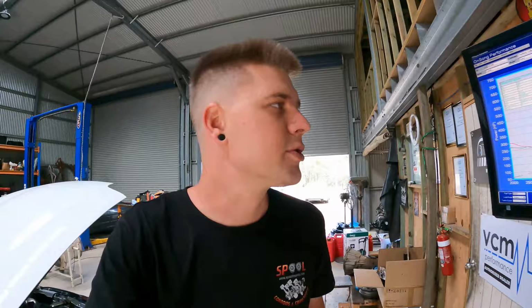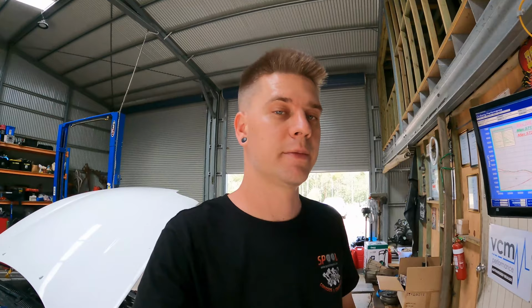The knock control set up, I'm super happy with everything. I think Cody's super happy with everything. All I've got to do is just work on the cold start. Probably not tomorrow. It's annoying, I'm going to have to wait until I get the coil pack to do the cold start, because there's no point in doing the cold start while it's missing on one cylinder, because it's not going to be a very accurate representation of what it's doing for fueling or anything. So that's a real pain.